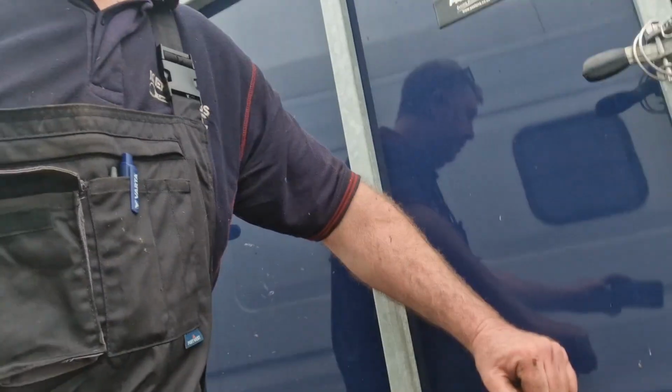Right then guys, that's the Ifor Williams horsebox trailer all serviced, and there wasn't any faults on it. It was all good. Routine servicing, adjusting the brakes, checking the tyres, most importantly checking the floor and the side panels here. That's the most important thing, that floor. You've got to really check the floors on all these horse boxes, because if a horse goes through one of those floors, that's catastrophic. So yep, flooring, brakes, tyres, most important.